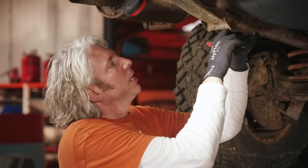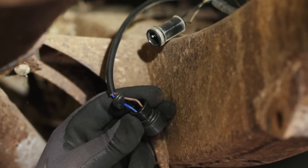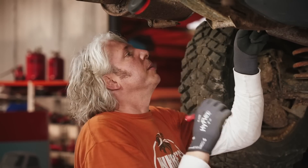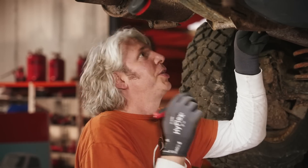Right, before I forget which was which, I'm going to put my brown wire where the blue wire used to be, and the blue wire where the brown wire used to be. The only issue I can see is the little grommet, but I think we can wiggle it around enough. Look at that — fantastic. So we've now got our connectors back in the plug and the wires, although they're now colour-coded wrong, are correct for the fuel pump, which means I can pop the dust cover back in, reconnect it, and our pump should produce fuel all the way into the engine bay.